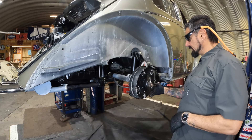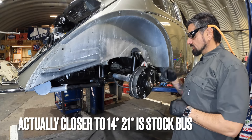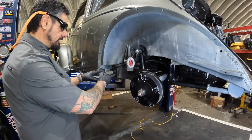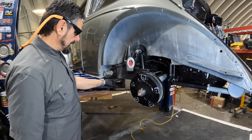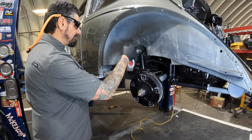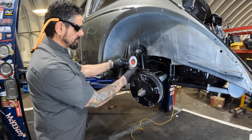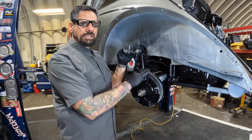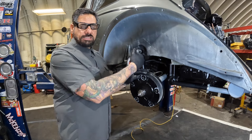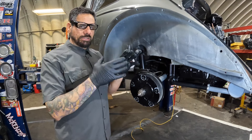With everything disconnected in a full relaxed state, this should be reading about 21 degrees. We've already got the other side taken apart — this spring plate is completely relaxed and there's a gap underneath here, which is kind of nuts. We're reading negative five degrees on this side, as opposed to the positive angle we should be seeing. So this car came in not only extremely squatted, but not even level left to right — negative five degrees on one side, positive three degrees on the other, almost like it's twisted.